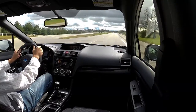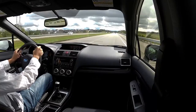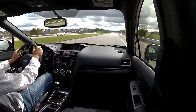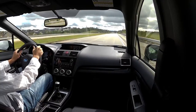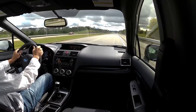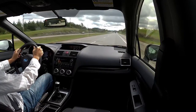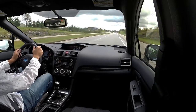I replaced the clutch in my RX8 and a thousand miles later — I think it was the clutch master cylinder — it went, and the clutch started dragging. It was a cold day and I pulled over; the clutch had gotten so hot that the disc and the flywheel actually fused together. It just ruined my brand new clutch and flywheel and I had to go through it all over again.